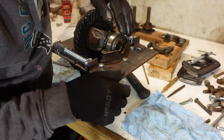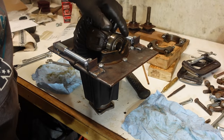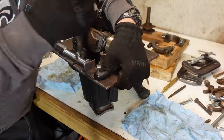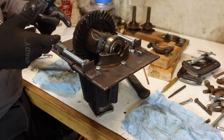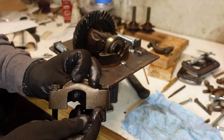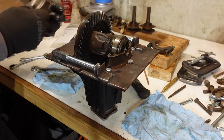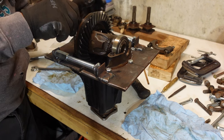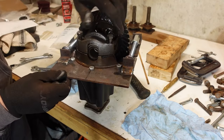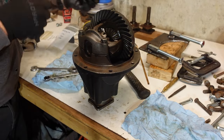I think I got it. Holy cow, it actually worked! All right, we'll take the tension off. I'm going to put the bearing caps on first. These have little letters on them — there's an X on this one and an X on that side, and this one's got a U on it and a U on that side — so they're kind enough to line them up for you. Make sure I don't have the shims pinched in there. They feel good. Tighten these caps down.